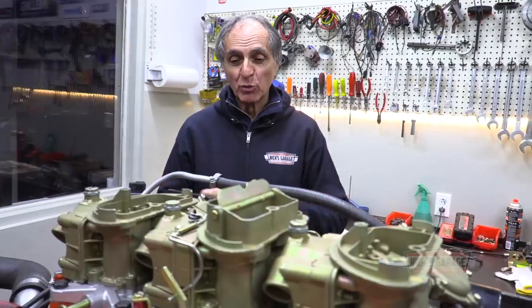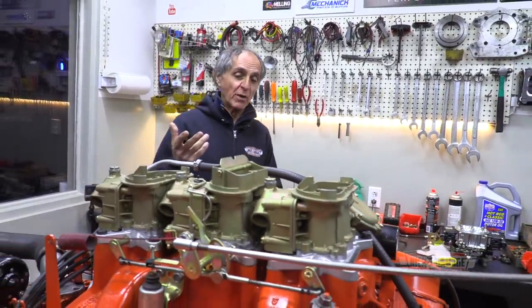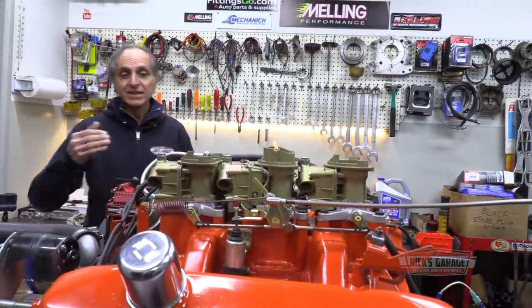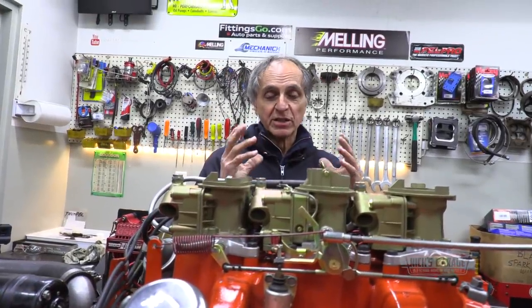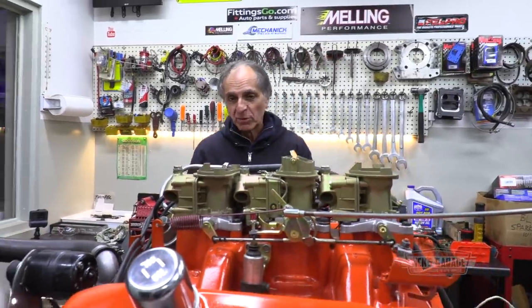But anyways, doesn't matter. We're gonna see the raw horsepower, which is measured power, versus corrected power, which gives you the correct reading no matter what day it is. If you go with the SAE standards, corrected tells you it's all the right humidity, air temperature, the right barometer, and so forth. So let's go with the corrected power, see what we get.